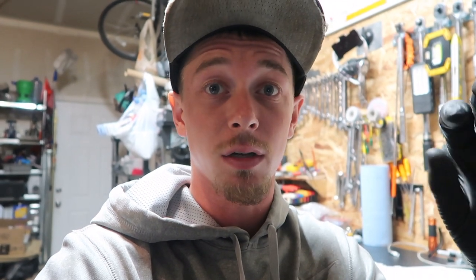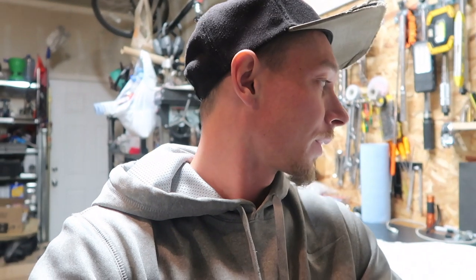One thing I will say: if you're working with fiberglass, definitely wear long sleeves and definitely wear gloves, because you will be itchy for sure. Leave those in the garage, throw the gloves away, and then immediately go take a shower. If you don't want to wear a long sleeve in the middle of summer, get some baby powder — it'll actually clog the pores on your arms so fiberglass won't get in, making it a lot less itchy. Two tips right there.